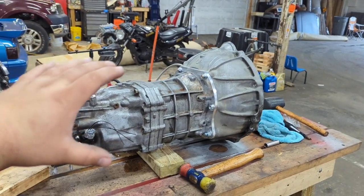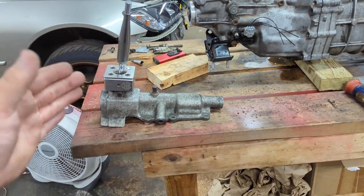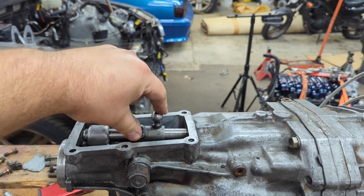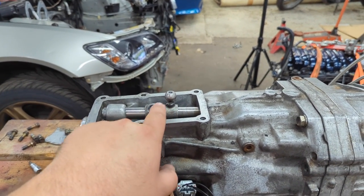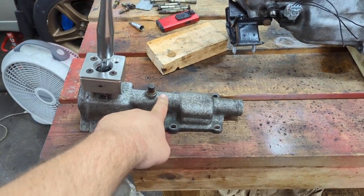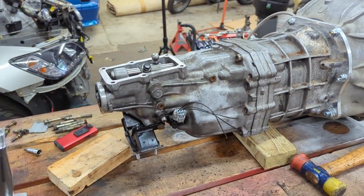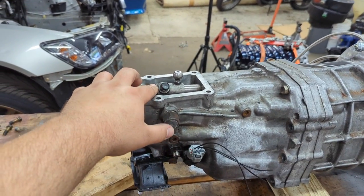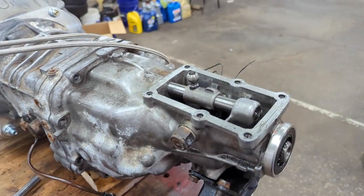I thought I was ready to install the engine to the transmission, but I checked the shifter and it does not work — it binds up as soon as it's bolted on. Here's why: when I swapped the shifter extension piece, the threaded hole on the W58 shaft is half an inch further forward than on the W55, so the W55 piece will not work on the W58 shaft. I need to take both transmissions back apart and swap the shift shaft itself. I'm not going to film that since you already saw how it's done.